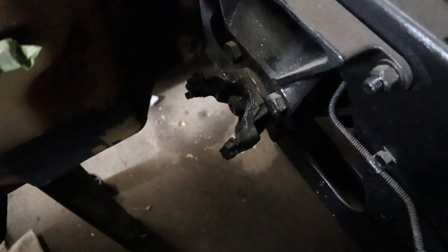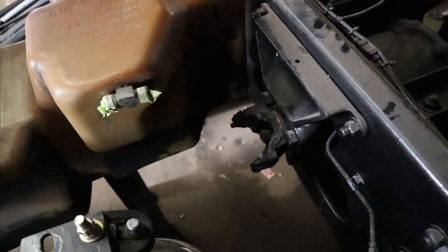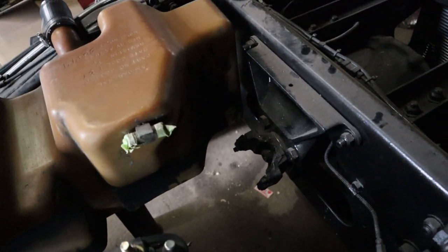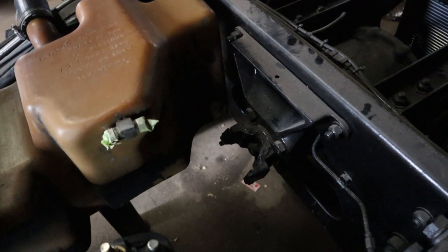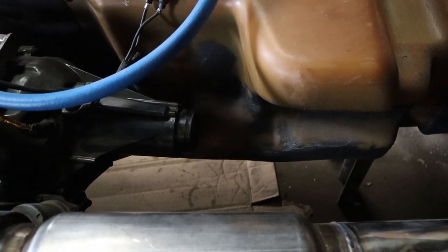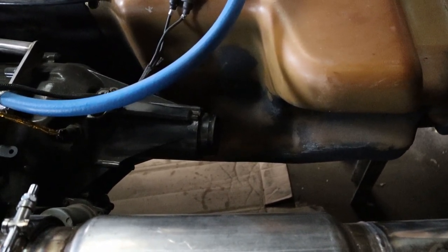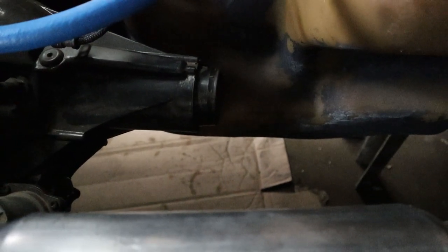The plan is to use a 1330 in the back so I don't need to replace anything back there, and also limited space means you don't want to go too big. A 1330 is actually the same cap diameter as a 1310, and a 1350 is basically the same cross-section cap-to-cap but has bigger caps. I'm hoping we actually have enough room up front to run a 1350 to 1350, and then from the driveshaft back either run a 1350-to-1330 adapter or just go 1350 all the way up front with 1330s on the back.